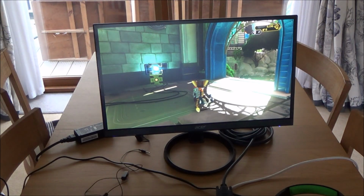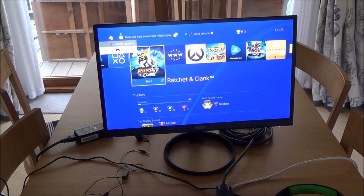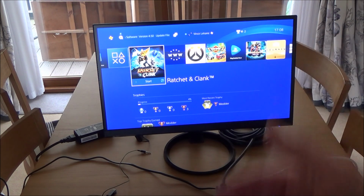Right, okay, just pause that. So now, what do you do if you're having problems doing this? What may happen is, it might be set up, for example, this might have been set up elsewhere, so it might not be on automatic settings. So you might have to start it in safe boot mode, or if you've got another TV to work off, what you can do is you can turn the HDCP off, and then that might solve your problem when you bring it back to your monitor.